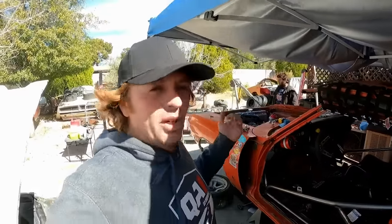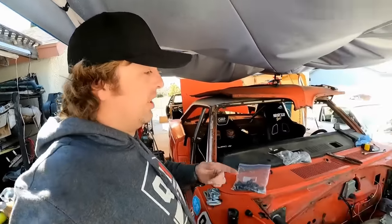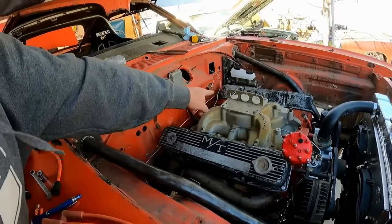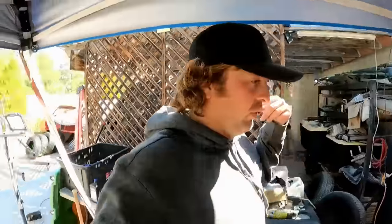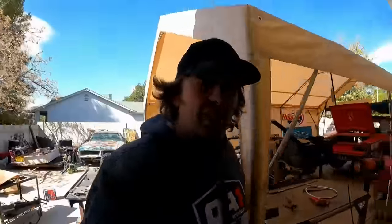I know it won't look like much, but yesterday was a lot of progress on this thing. To make further progress, I need to get the carburetor on it. Oh, I started modifying the throttle linkage bracket that actually holds the cable, because this taller intake manifold, the stock setup won't work with it. So I started on that last night, but then it got a little bit late and we started drinking beer, and then, of course, progress stopped. And right now I am actually working on El Carburetor.